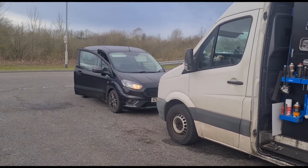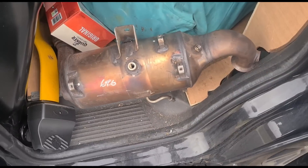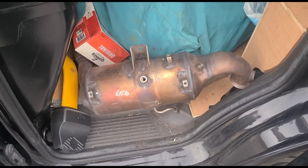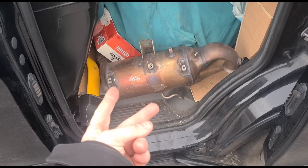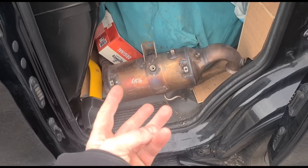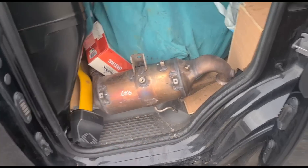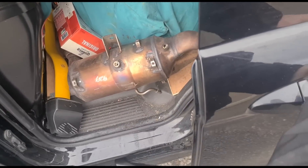Hello, it's Jimmy here. Got here to look at a Ford Transit Courier. This vehicle has got a very long story behind it. It's had a replacement DPF — and this is the old one — a new EGR valve, exhaust gas temperature sensors, DPF pressure sensor, NOx sensors. The list goes on. He's given me a list for about half an hour of what parts have been replaced on it.